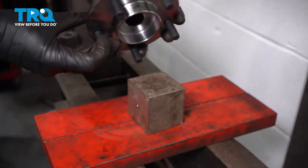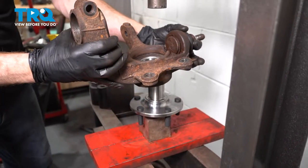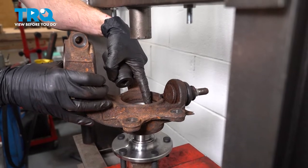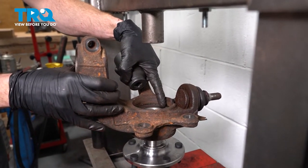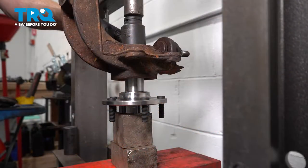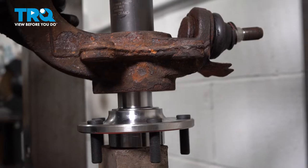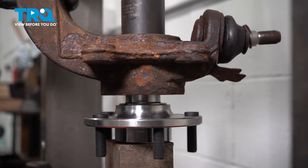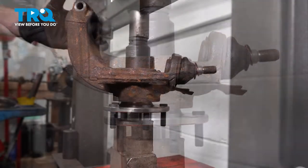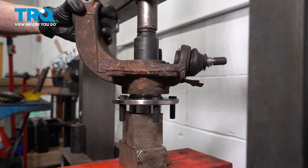The next thing you want to do is take that hub and rest it down on the center area on a riser so you're sure that you do not damage your lug studs. Let's take the steering knuckle with bearing and we'll slide it into position right over that bearing hub. Continue on with a spacer that fits directly over the center area here. While we're doing this, you do not want to press anywhere other than the center. Don't press on the magnet strip or on your snap ring. Now we can continue on by pressing this down and into position. While I was pressing this down, I could hear an audible difference. It sounded as though it was completely bottomed out. Have a look down in this area to confirm it. Once you're sure it looks good, go ahead and remove it from the press.